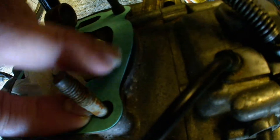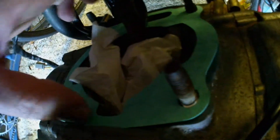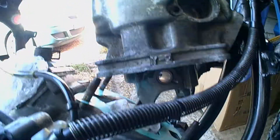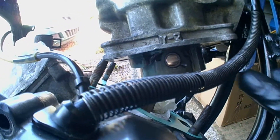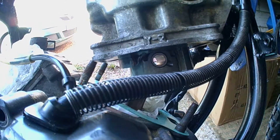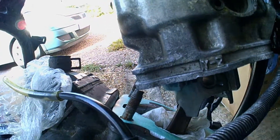With the dowels and the shape, there was only one way this was ever going to go on, but it's not the most perfect fit — there's some sort of resistance at the back here. That might be by design. There's a gudgeon pin that's gone through the piston almost to the other side. Just got to push it through a little bit further, fit the gudgeon pin, and we'll seat it down — removing this bit of rag.